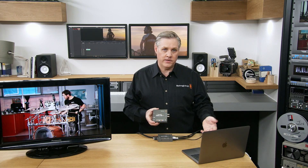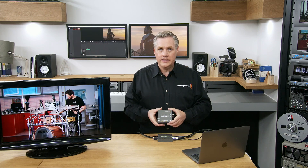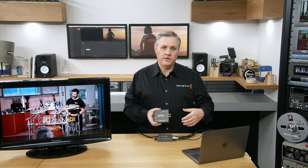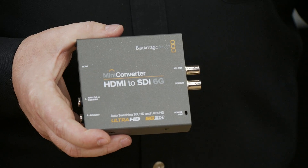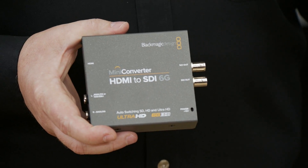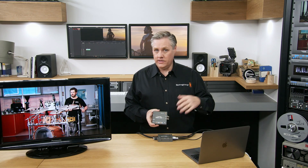It's very easy to use, just like the other model. It works with any HDMI computer or camera — it doesn't work with encrypted HDMI sources for copyright reasons. It'll watch the HDMI input and instantly switch standards when it changes. There's no need to change settings when moving between SD, HD and Ultra HD. Like the other model it supports all SD, 720p, 1080p, 1080i and 2160p. It supports all the SDI data rates from 270 megabit, 1.5G, 3G and 6G SDI. You can also select on the output whether you want 3G SDI level A or level B.